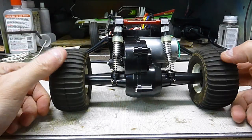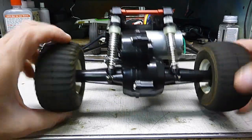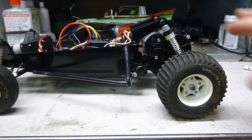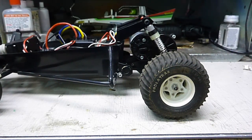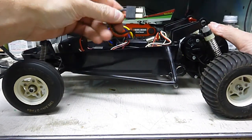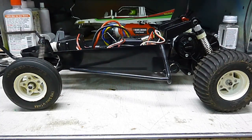You really don't need to put that much grease. You could use a little less — if you wanted, you could use a hard bristle paint brush, a little one, and just smear a thin coating on the gears. This looks like it works really good. You'll see the difference when you ride your buggy or car with this on the open diff — you'll get much better traction. This will help it pull and get you out of situations you'd normally get stuck in. Anyway, I've got to change the plug because my buddy used Traxxas plugs and I use Dean's ones, and I'll be ready to run this beauty. See you next time. Hope you enjoyed this. Bye.